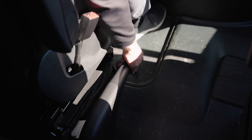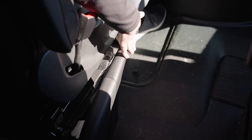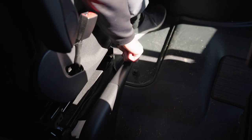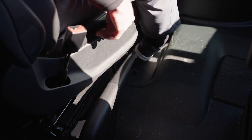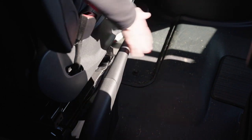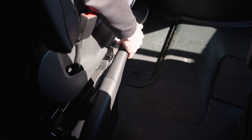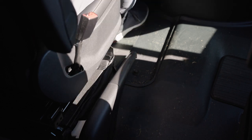Let's look at the parking brake now. When you're camped out you want the parking brake engaged, but in order to give you more room in the back of the coach you also want to swivel your seat around. While keeping the parking brake engaged, without pulling up to release it, just press straight down on it — you're in limp mode now. That will allow you to swivel your seat while keeping the parking brake engaged. When you're ready to roll off, pull that brake back up with a good pull; if you don't give it a good pull it will remain engaged. If you're in limp mode, give it a good yank all the way up and you should see the light go off on your dash.